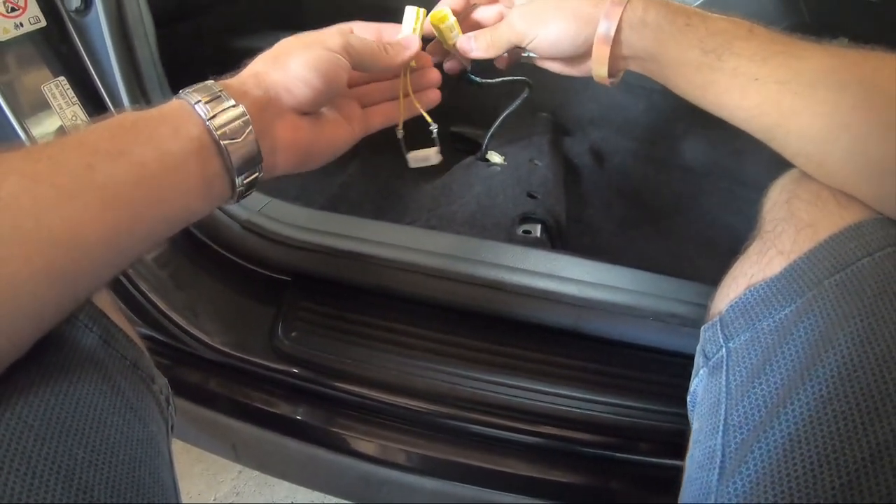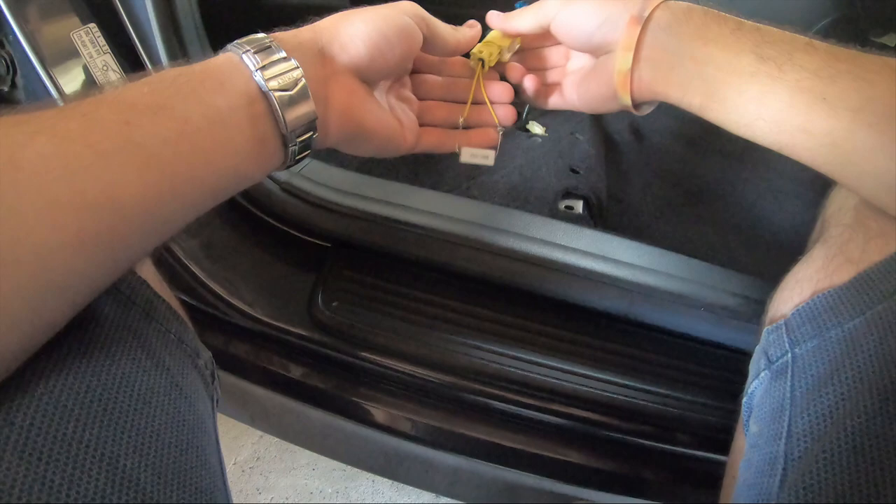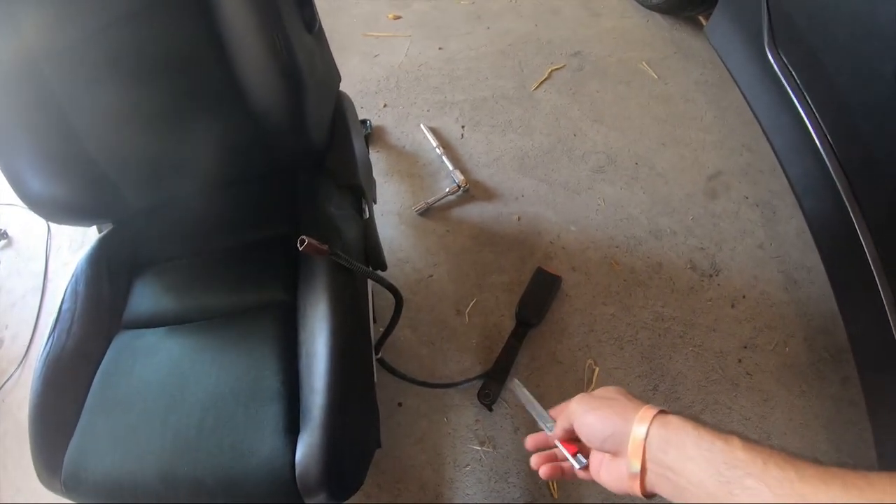By no means was that the best solder in the world, but it was a solder. Now it's just as simple as lining the two parts back up. It's worth mentioning — if unlike me you're only doing one side, you can actually take the two wires from the resistor and plug them straight into the female connector. Those two wires will go in — it is a snug fit but make sure to wrap some tape around it so it stays in, because if those connectors disconnect you've got to reset your airbag system and that's a whole other kettle of fish. Make sure at any point when you're fiddling with these electronics, disconnect the battery otherwise you could have trouble.